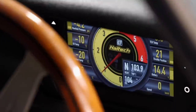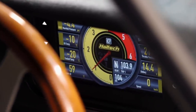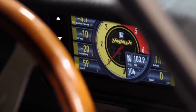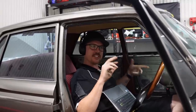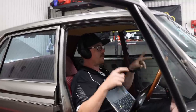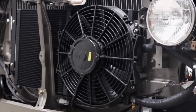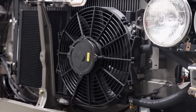Yeah, you like the Haltech Nexus R5? Yeah, it's amazing. But yeah, so we've gone through, verified trigger angle. We found that the sensor was flipped around polarity, so we've fixed that. We've got the trigger offset set. We've then gone through and just started setting up some of these lovely pulse width modulated outputs, things like thermo fans and intercooler pumps and that sort of stuff. Just make sure everything works.